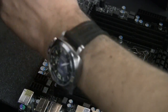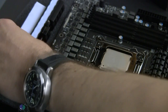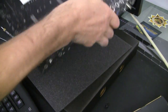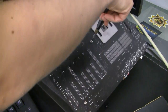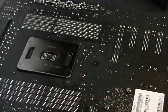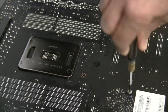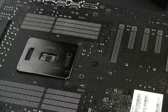Take the screws completely out. Both screws on both sides need to be removed completely in order to remove the heat sink. Part one is done; now we need to unscrew three more screws to get rid of the other part. You may want to give some support for the motherboard from the other side. If you have an anti-static wrist strap, that wouldn't hurt - I'm kind of skipping on that, but if you want to be 100% safe you may consider using it.